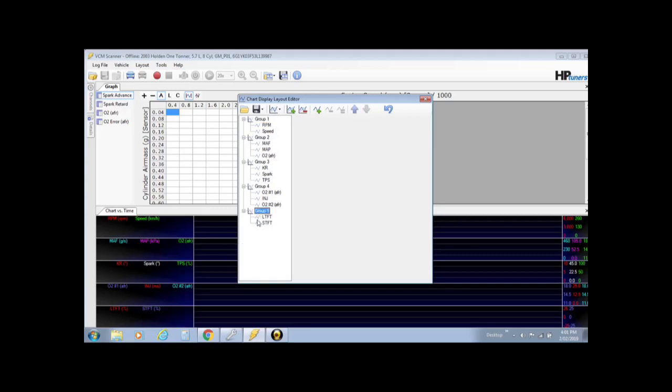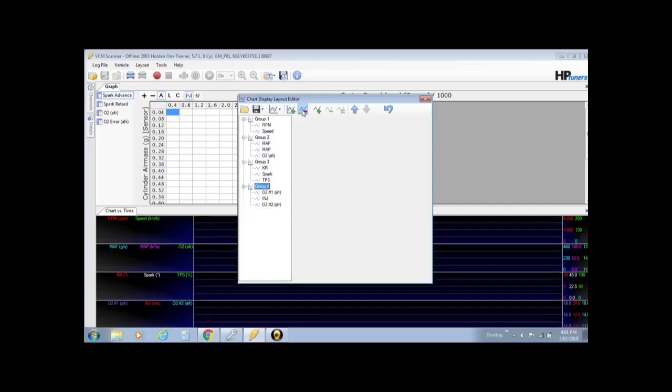Now let's straight away start off by trimming some. Group 5, long and short term fuel trims, I do not need to know that. It means nothing to me, so nothing in group 5 means anything to me. So let's get rid of the group, gets rid of the row. The O2 sensors, they're the factory ones in the exhaust it's talking about there, and injector in milliseconds, injector duty time maybe, something like that. Absolutely no need for that. Let's get rid of that.